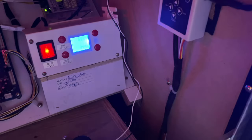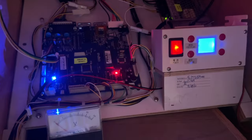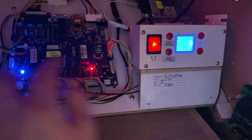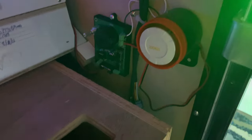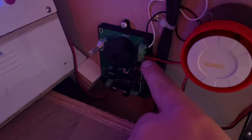I'll mount the alarm board down here low so it still allows access to the LCD if you ever need to remove it, and then I'll attach the siren somewhere over here. The wires for the aftermarket alarm just run along with the harness — you could zip tie it up — and then they run under here, down and over to the side, and the wiring for the siren goes there.